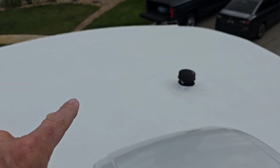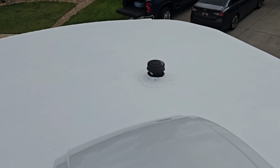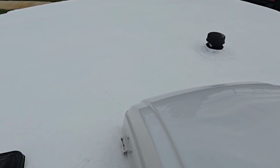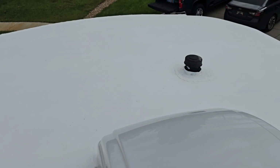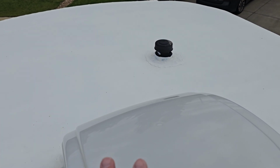And I got Maxx vent videos I can link, and my roof looks like it's been coated. I do this also to all my trailers, and I'll have a separate video link below. You can do it for less than about 150 bucks and add not only UV protection, but seal it up good so there's no more self-leveling caulk you got to do every year. And you can come up and maintain this if you want, but it actually adds a ton of value to it.